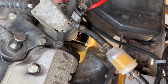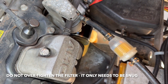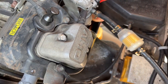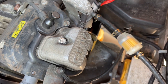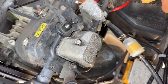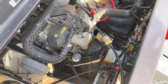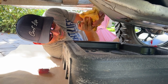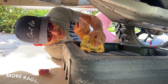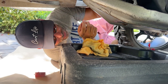Put it back on. With these, you don't want to over-tighten them either — it just makes it harder to get them off later on. Just do it until you feel like it's nice and snug. The gasket in there and the oil will create a seal and you won't have any leaks. Not a drop of oil anywhere. We got a very slow drip of oil which means we're basically drained out. I'm going to give this a wipe, get any extra residue off, and put the plug back in. I checked it — there's no metal shavings or anything of concern.